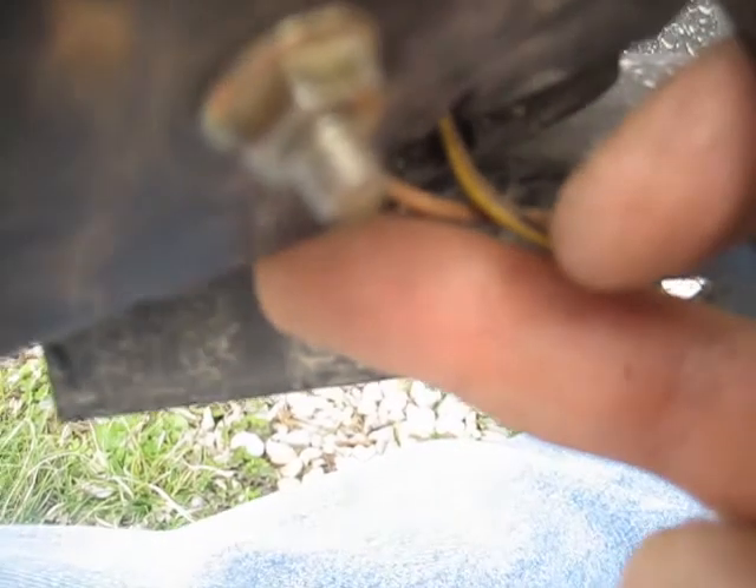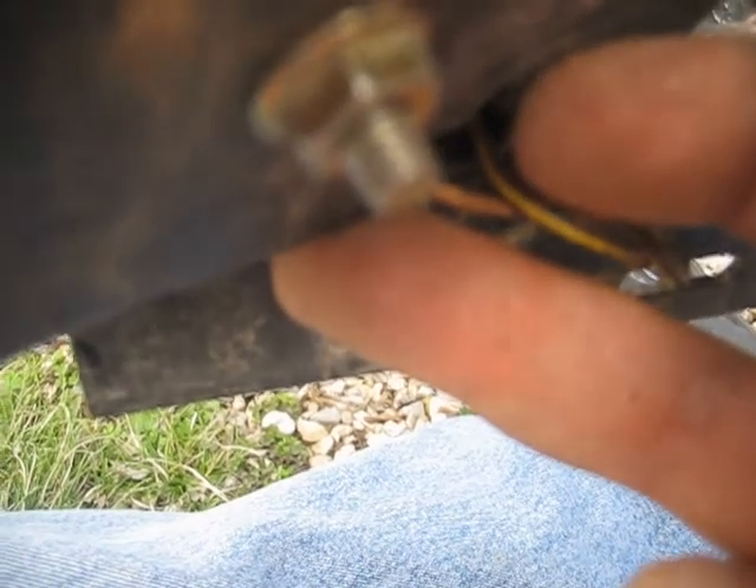When bringing the bolt down, you'll see the knurled edges on the bolt. The housing has the same knurled edges — you want to line that bolt up until it sits right inside those spaces in the housing, then take your nut on the back side and tighten it down like normal. When it stops, put a small snug on it. Don't go too much or you'll crack the housing. Then take the nut off, remount it to the bracket, and test it.